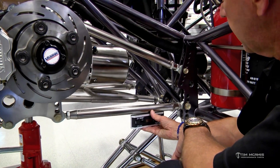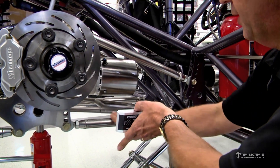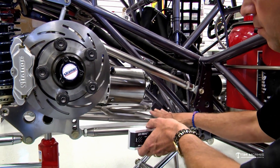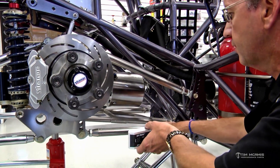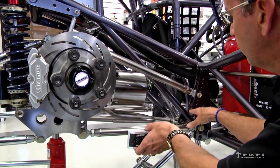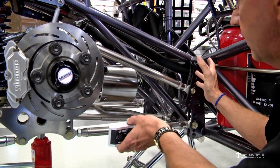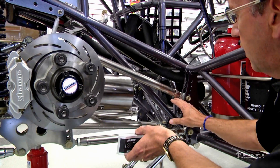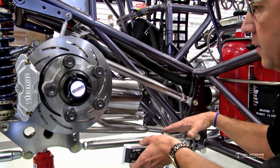So that bar, if I put it at 0, means that bar is running downhill. If this bar were level, that would be a baseline for our intersect point. From more bite to less — if the car had too much bite, the driveshaft speed was slow, and it was trying to rattle the tire, you would raise the front of this bar up. You'd pull this up, but you need to keep your spread the same. So if you've got that 55-inch number, raise both holes up, keep the spread the same, and as you move this up, it will not try to compress the rear — it will actually try to spread it and let the tire spin easier.